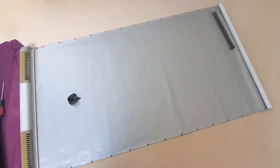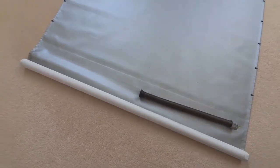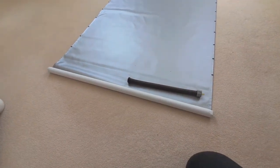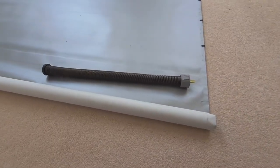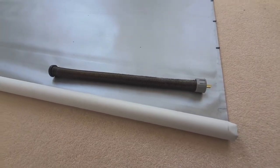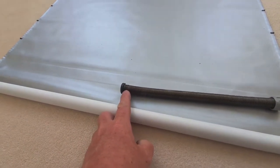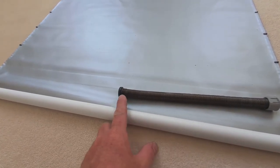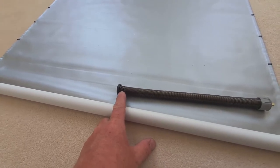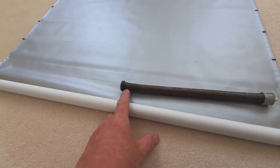You're going to want to take the sides off those black ends, and then what you're going to find is at the end you need to put the tension back into the spring. Initially I was just turning and turning and nothing was happening. If you pull one end out, what I found was this end part has got some threads on it to take the spring, and it had completely come away. Whether that was me turning it the wrong way I don't know, but basically you need to screw those back into the threads on this end so it holds.